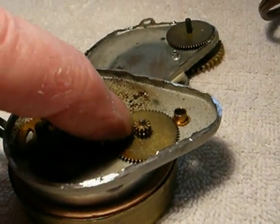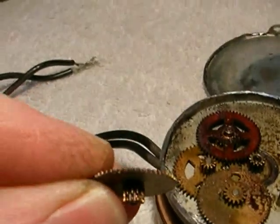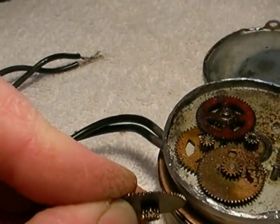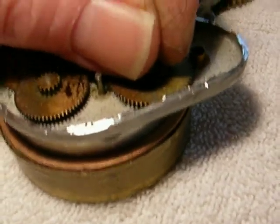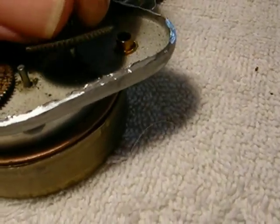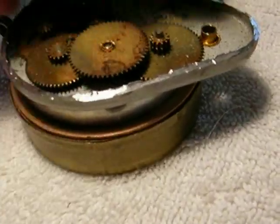Here's the fix — the missing teeth in the gear are in a very narrow line, and there's a lot of unused gear material on this thing. The gear just has to be moved up a little bit. What you do is take a plain flat washer and put it underneath this gear. That's going to lift the gear up into an unused portion of the original mangled gear.